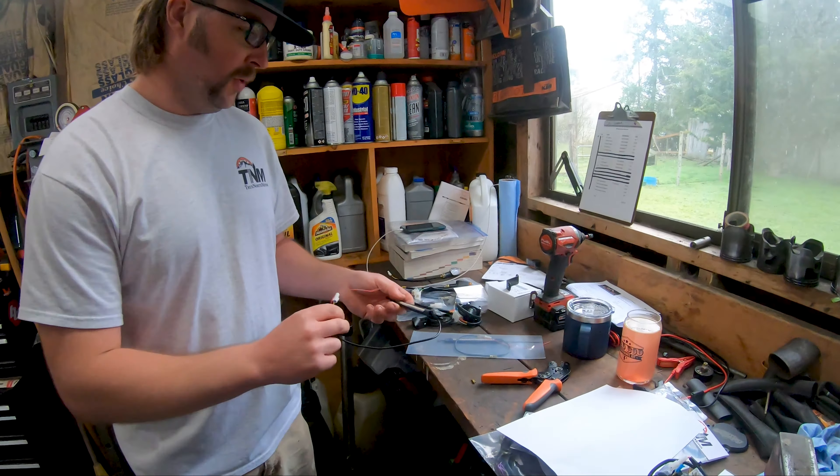This one's already done, but I'm just going to show you. What's happened here is I've stripped these wires on the red. I've clipped just as little as I can to get the old connector off and stripped that white wire. Now you're going to take the new headlight connector that comes with your turn signals, and then you're going to run all three of those wires together.